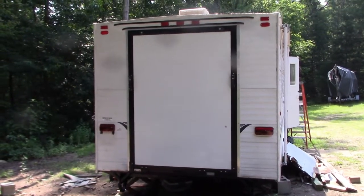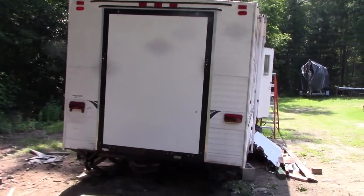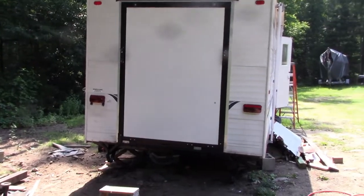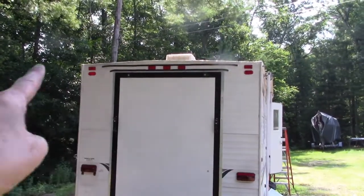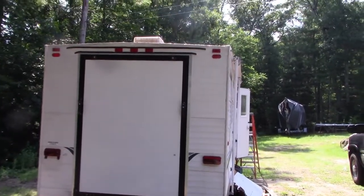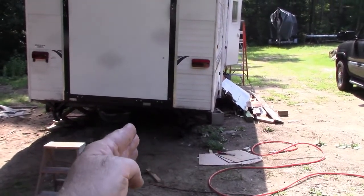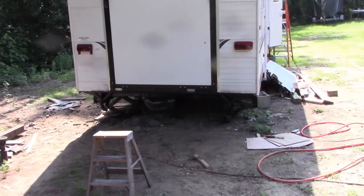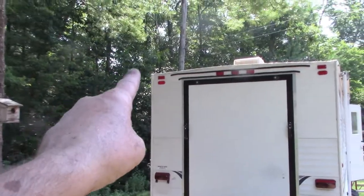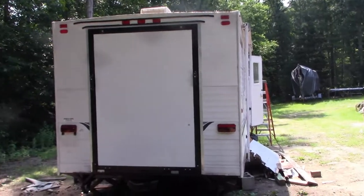Alright folks, the exterior of the camper conversion is done. So I've got the aluminum trim around the outside that the gasket on the door seals against. I put the gasket on the door. I got some rain gutter across the top of the trim, and overall reinforced where the rear bumper was cut off to prevent the deflection of the I-beam, and everything is weathered in. So I've got silicone around all the light fixtures. I've changed all of the lights to LED bulbs or fixtures.